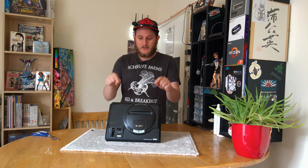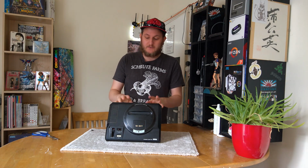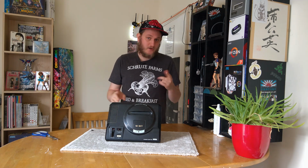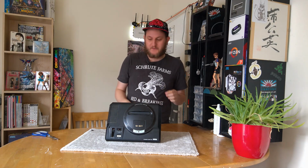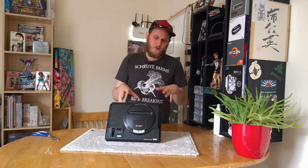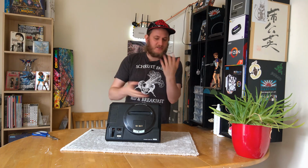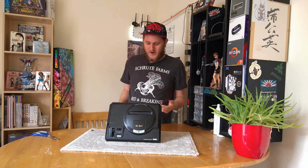The only thing I do know is that this particular Mega Drive is not outputting an image, or presumably sound either, as when I plug it into my TV through both of the possible outputs, I get nothing, black screen. I know that the TV works fine because I have put other consoles on it with no problem. And as I say, I've tried two different cables on this, so something somewhere is wrong, probably somewhere along the video processing to output circuits, analog, whatever is going on in there.